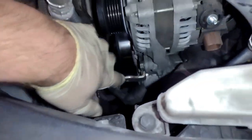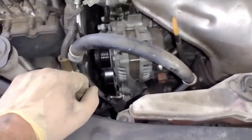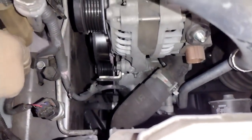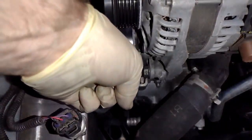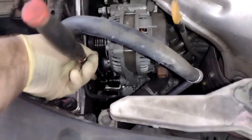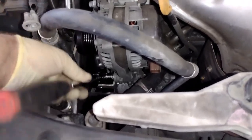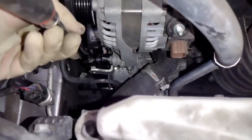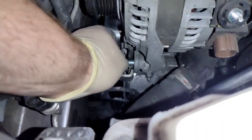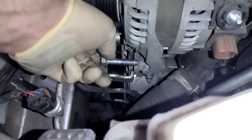Let's see. Let's get down here. Get any of the wire harness off any more spots. I think there's like a 10 millimeter bolt down there. Yeah, there's a 10 millimeter. Okay, so got this clear down here. Now, gonna take this bolt off for the wire harness guide. Go ahead and get this off. This is going to be in the way for the water pump anyway, so I'm just going to remove it now. All right, got this off. All right, that's a long one.